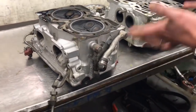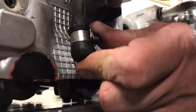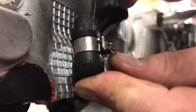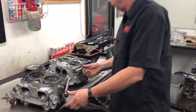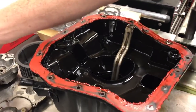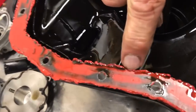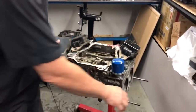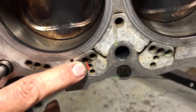The water fittings on a B4 engine are also different. Some have been blanked off, but in particular you can see one there that is so old it's actually fatiguing already — if that splits, you've got high-pressure water coming out of the inside of the engine, and the first thing you know the engine is going to overheat. Also, you'll notice everywhere they've used non-genuine sealant, and it looks like the original owner has used as much as he mechanically could. You can see the amount of sealant squeezing out on the inside, and parts of it have broken off and gone through the engine. When we pulled the heads off you can see a little bit of red sealant stuck in the water jacket.